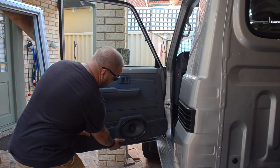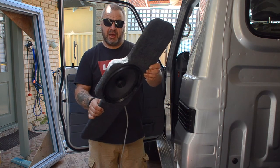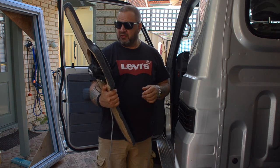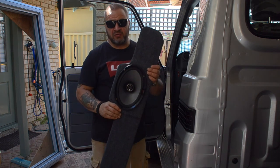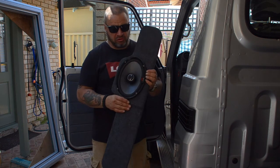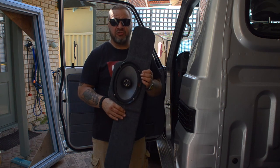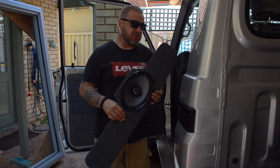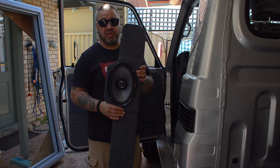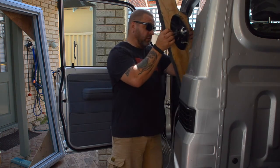As you can see it will fit down here in the door. The speakers I've gone for are Alpine - the RS69Rs, which are Alpine's top of the range 6x9 speakers. These will deliver a good level of bass and they've got built-in tweeters so they'll deliver the higher frequency ranges as well. These should be a significant improvement over the original factory fitted speakers, and in conjunction with the head unit already fitted I should see a marked improvement in audio quality.